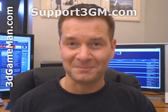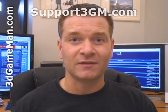This is an exceptional case, right from the outside to the inside. It's the type of case that you want to own because it does have so many excellent features. Now I have a couple of personal preferences when selecting a case. Generally speaking, I look for a case that's aluminum because it means that it's going to be a little bit lighter than steel, but of course steel, generally speaking, will be a little bit sturdier than aluminum, but it will weigh more.